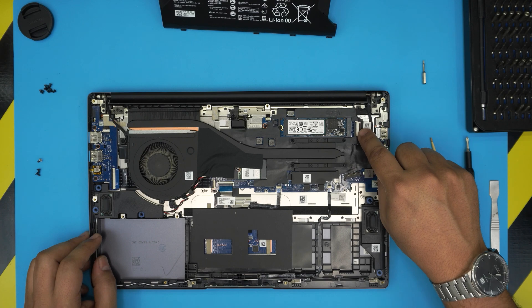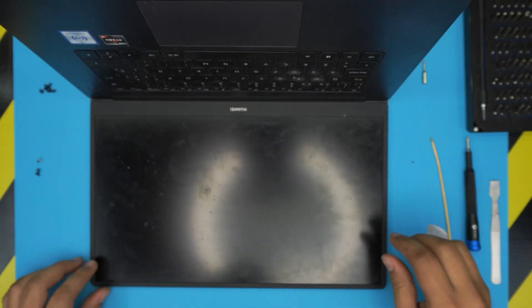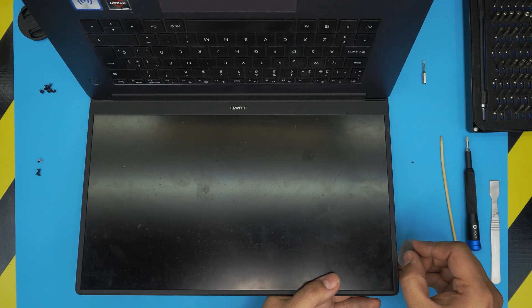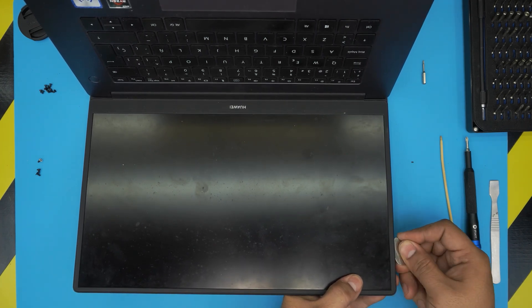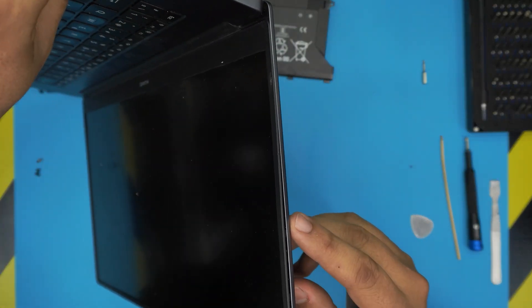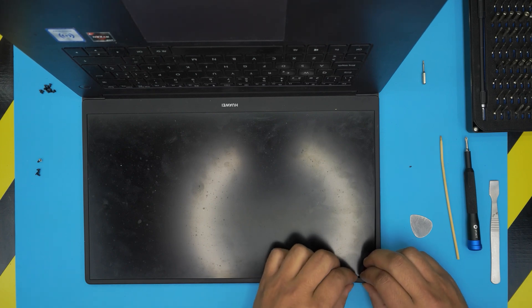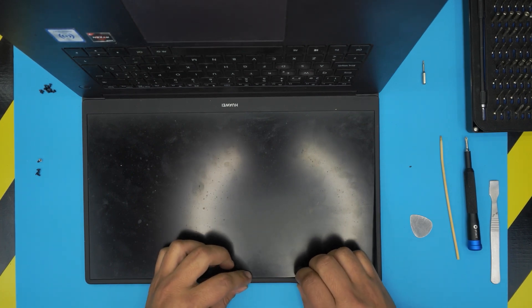Now that the battery is disconnected, we're not going to remove the LCD cable or hinges — we're just going to remove the bezel. The proper way is to start from one corner, not the middle or top. Stick the guitar pick between the casing and the bezel and gently twist it in and out, listening for the bezel clips releasing. Work all the way around to the bottom. Once it's slightly open, put your finger in and lift, twisting left and right to release the clips — don't pull straight up or you'll break it.